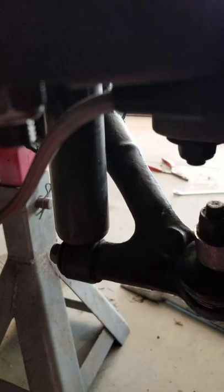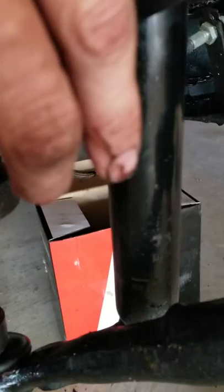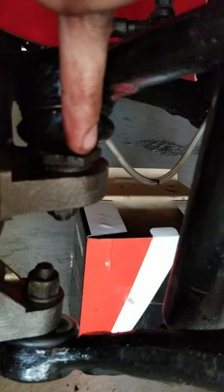Washers go behind it. So loosen each one, okay? Don't take any off completely. Get your pickle fork in there, coming at the side between top and bottom, slam your pickle fork in and get it broken up.